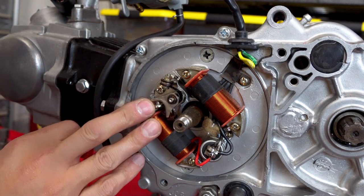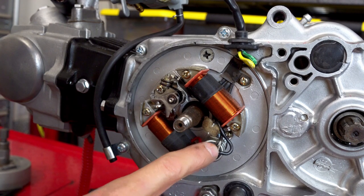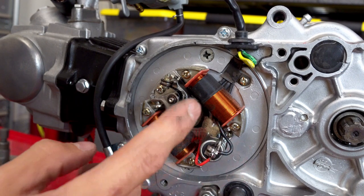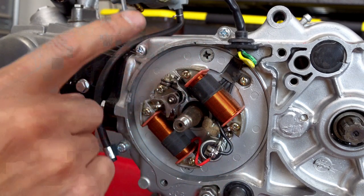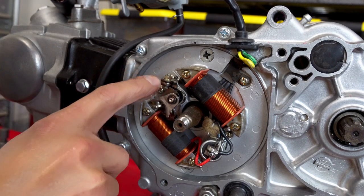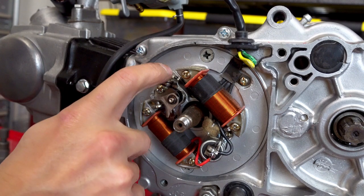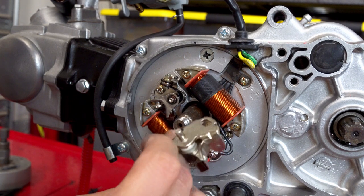I also checked continuity. I took all three of the lines that go into the condenser — one is the main plug from the top that comes down, one is from the top part of the points, and the other is from the main coil. I had desoldered and re-soldered this many times and changed out the condenser. I checked continuity between the lines to make sure they weren't grounded. When I checked the points it was grounded, but that makes sense because without the flywheel and cam it goes to an automatic closed position. It was a light bulb moment though when I realized that when I opened the points, that line was still staying grounded, which didn't make sense.